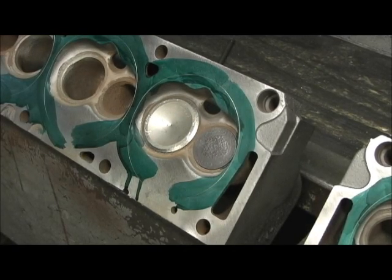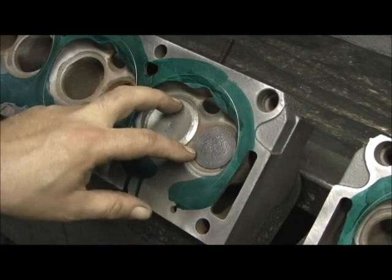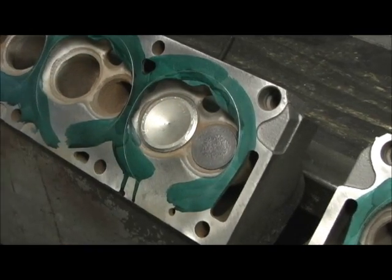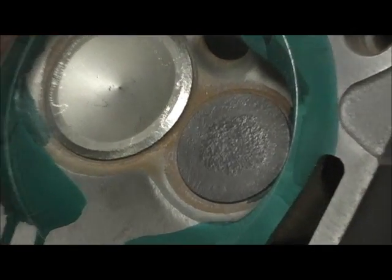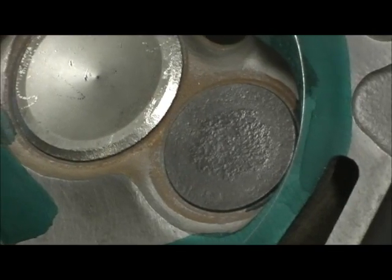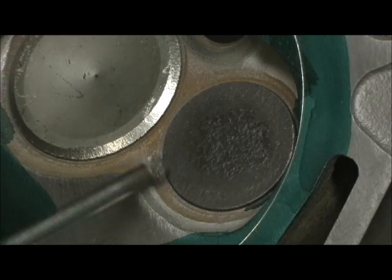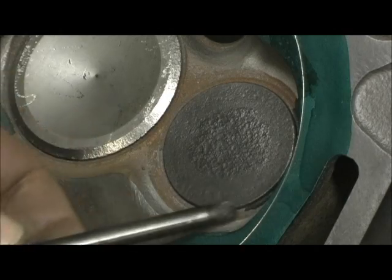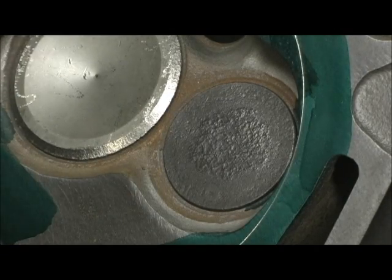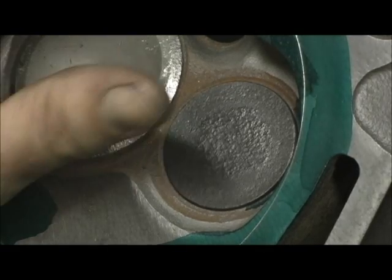I had to turn my fan off. As we left off, I got the combustion chambers ready. Now these grooves right here that you're seeing are partially machinist ridges, but I've already gone in there with a bigger cutter and started grinding on them. What I've got to do is go in here with this ball and layer it in, then switch to a smaller ball, come in here on the quarters, expand out, and lay this chamber back. This is what's required with this head.